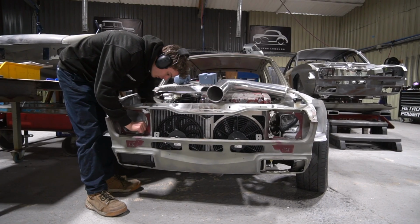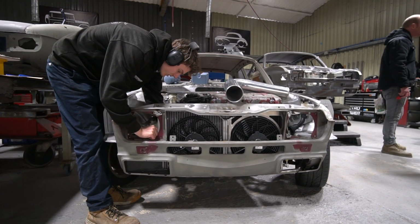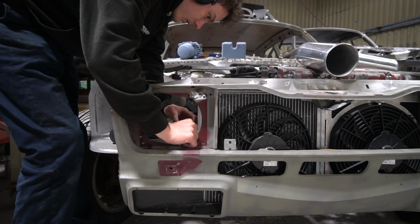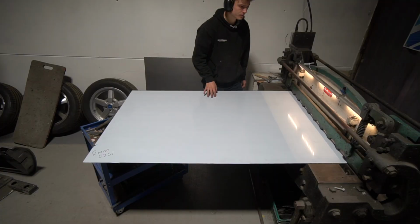radiator expansion tanks. We're using the Japanese style expansion tanks on these, what I would refer to as a Japanese style, where the radiator is completely filled with coolant, as per what the Hondas used originally, basically. So you completely fill the radiator with coolant. There's no internal expansion space within the cooling system.